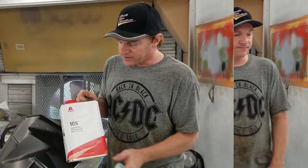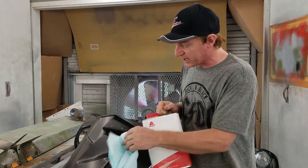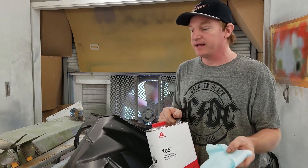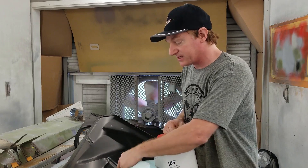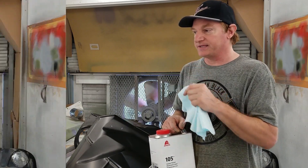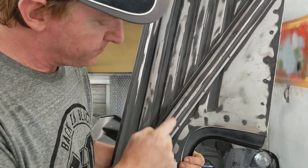The best way to check the EDP is to see if it regenerates with lacquer thinner. Here's our lacquer thinner and our E4143 Sunterra white. I'm going to use this to check an area on this particular coating. If it does regenerate, that means it's not going to be a well-protected coating — it's possible it could trap moisture and then rust out. On this piece of metal you can see what was scarring underneath the EDP coating — we'll have to sand the rest of that out.